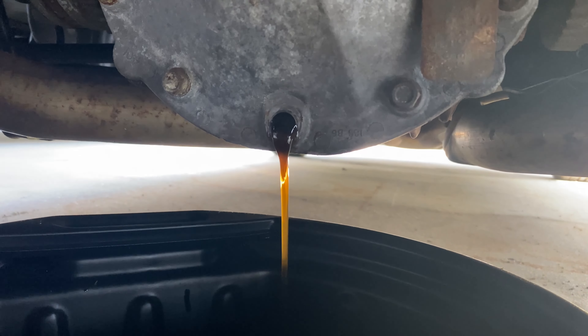Alright, it's all drained out - down to the last few drips. I'm going to plug it back up. I've seen videos where people used blue loctite - it looks like that's what was in it - and some people use nothing. I figured I'd throw some RTV on it, the oil-rated kind. It should do the job just fine and won't leak.